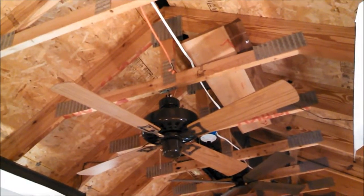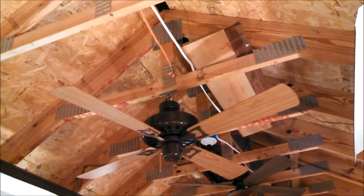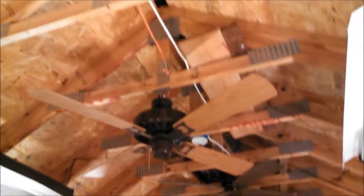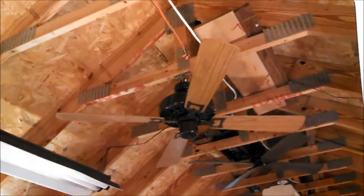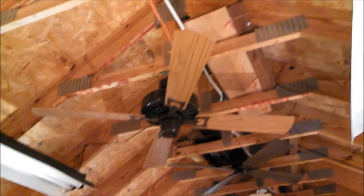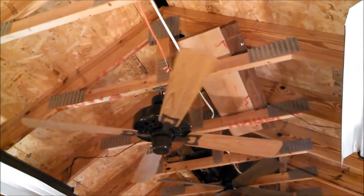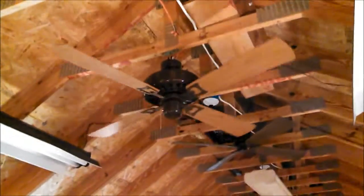1 microfarad. 2. 3. Wow, didn't think it would take this much. 4. I really like Sea Islands in the proper setting. Ooh, really? Was not expecting that either. 5.27 is what it takes to get this going. And that's the bearings tested good, and the cap is new.